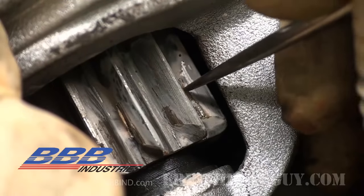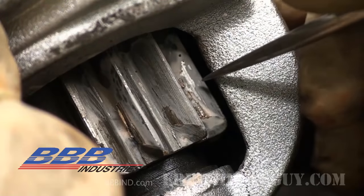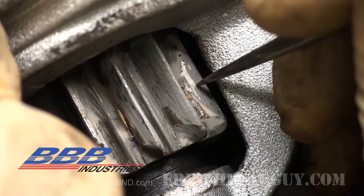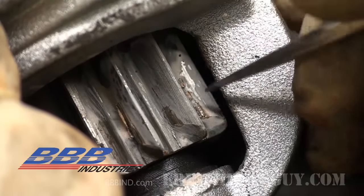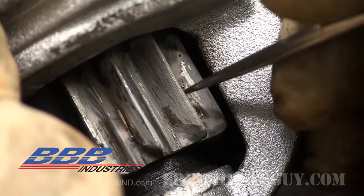Right in this middle area is what you're looking for — you don't want it to be all the way bottomed out. If it is, you want to add some shims. If it's only making contact up towards the top, you want to remove some shims, or just remove one shim from one side, in order to get it a little bit closer to the flywheel or flex plate. Now that you've determined the tooth contact pattern on the drive gear of the starter, you can install it back on the vehicle, reconnect the negative battery cable, and go on your merry way. If it was off a little bit, you can adjust the shims by adding or subtracting them in order to get correct alignment.